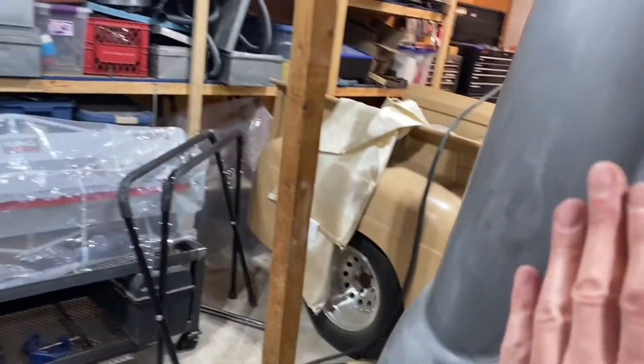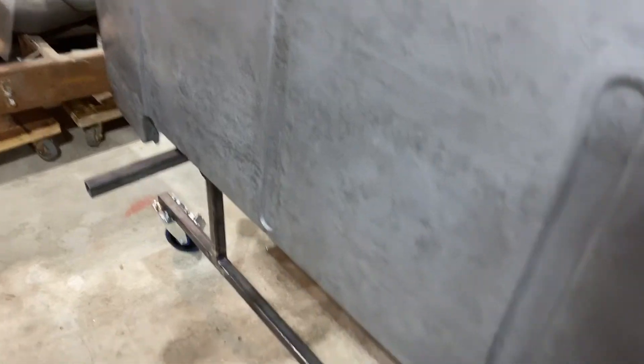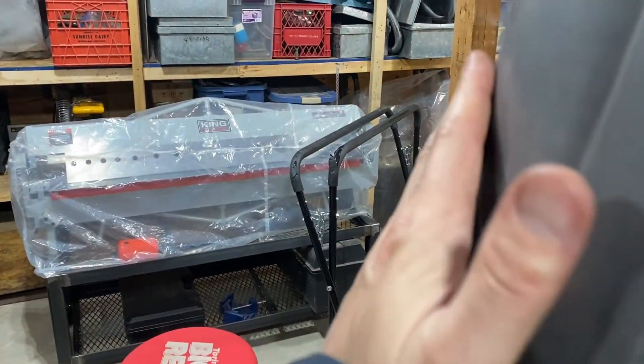What I'm thinking is on these corners, if I can have the corners really smooth, that's where people are going to see it — right here, up until about where the cab box comes in. I'll do my best on the back, but this will be less visible. Just tapping the metal gently stretches it out and takes these low spots out. We'll try and smooth it out slowly but surely. I might take the orbital sander on there just to see that — just smooth it out.